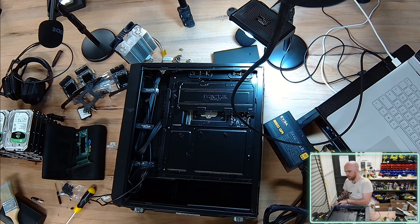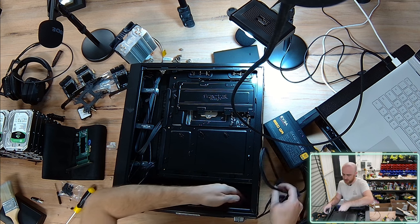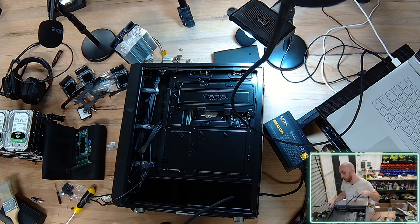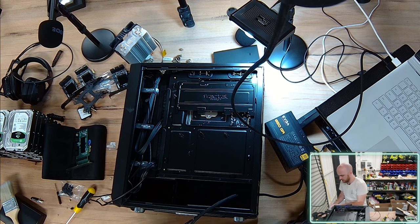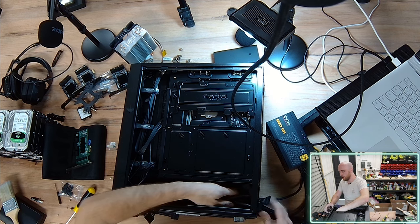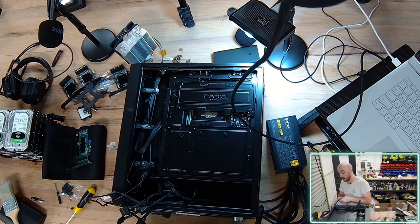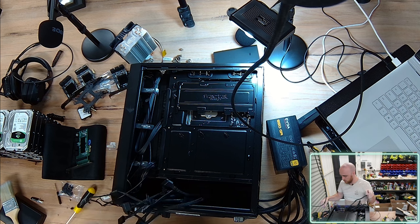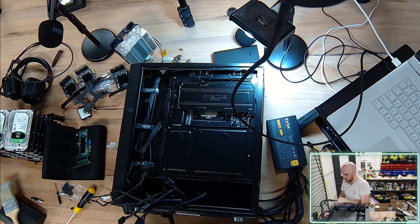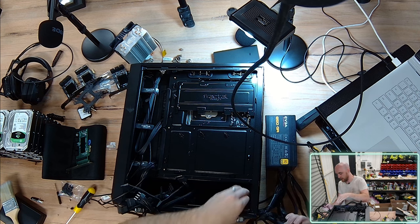It's 12 volt. SATA, from memory, I thought had 3 volt pins, 5 volt pins, 9 volt, 12 volt pins. I've got to look into what is actually used nowadays. Like, is 3 volt redundant? Because if the only thing that's used nowadays by the SATA power connectors is the 12 volt, then potentially I could get some GPU cable converters, because GPU cables are on the 12 volt rails. So I could convert from GPU cable over to SATA. And I do have spare, and there's plenty of power on this power supply, being that it's 850.